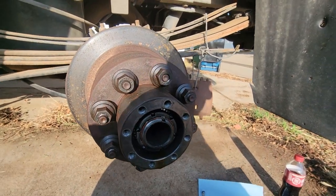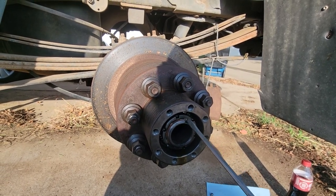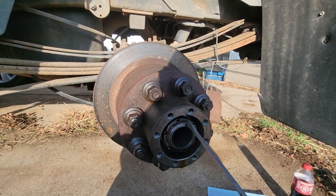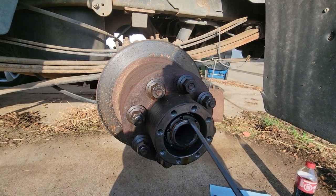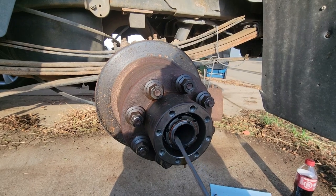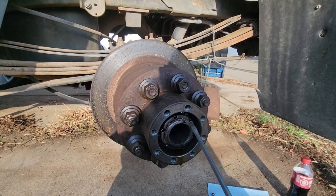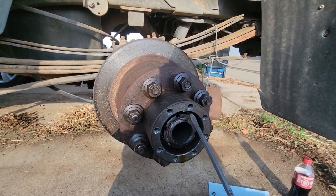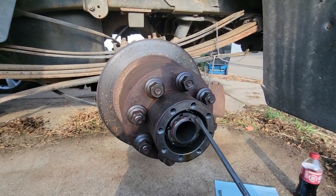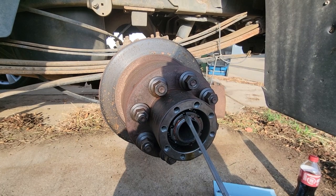Let me grab a pointer tool, also known as a screwdriver — or stabby bit depending on how you're using it. You take off this ring right here and we're gonna pull out that little key pin right there. If you don't see it on top — for me it just happened to be on top — actually it will be on top because this axle tube doesn't move. But it could be over here or wherever, I guess it depends on where they decide to drill it. You take that out and then this should come out — it should not be very tight.